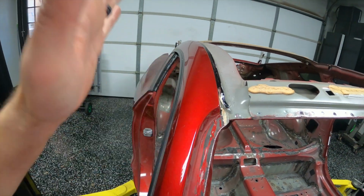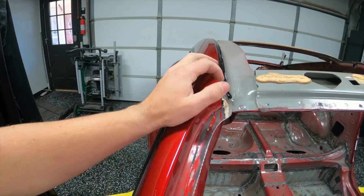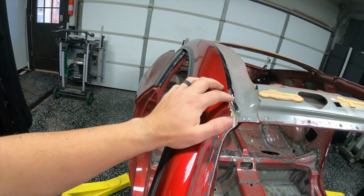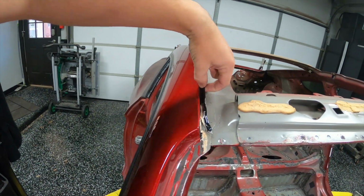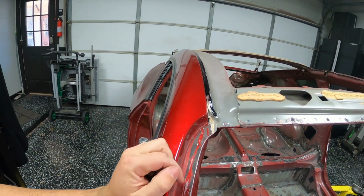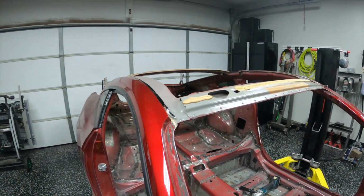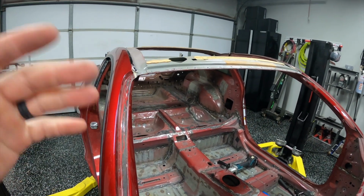If you are doing this without repainting your car, unlike me, this is going to be the most stressful part of the process, because you're going to have to get very, very close here and then grind it down. In all honesty, my recommendation would be to get a Dremel, because you just want to go really slow. Take this main lip off and then get the little drum sander on the Dremel or some similar type of miniature sanding tool to very slowly work your way down. For most people, I would recommend not attacking this until you have your carbon fiber roof in your hands.